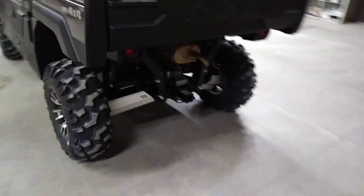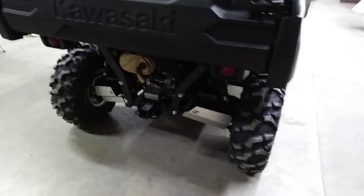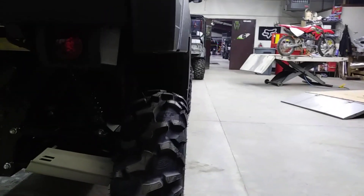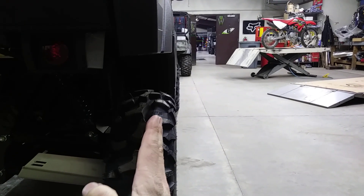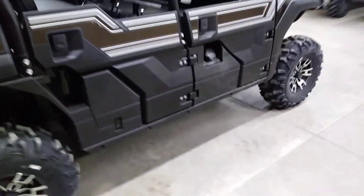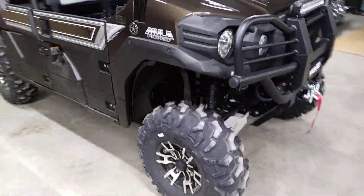We've got 17 inches of ground clearance with our lift and these tires. When we run the stock wheels and lift it, you're going to change the arch a little because you're pushing them down. So we run an inch and a half wheel spacer on all four corners, so the tires are flush with the body. That's why we do that — keeping maximum stability, keeping it to the edge of the body.